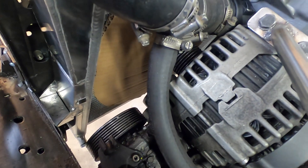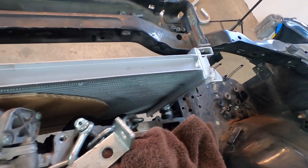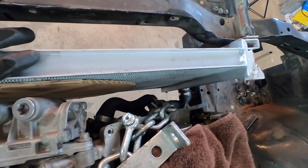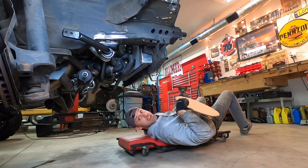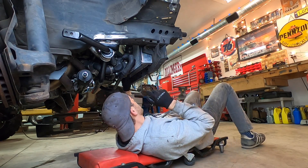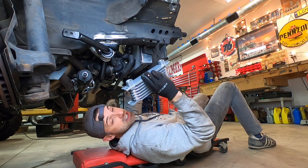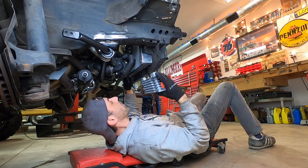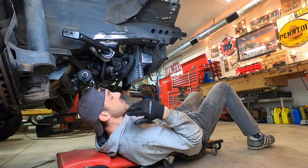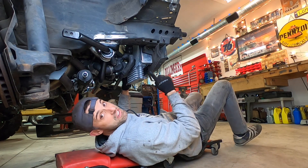I don't want a pusher fan — I want a puller fan to sit between the radiator and the engine, because with a shroud there it actually makes the effectiveness of cooling much better. With the offset look, it's actually going to allow for the oil cooler lines, which are located right here, to snake down the passenger side of the vehicle and go to the oil cooler, which I'm locating underneath the actual radiator. It's not going to be the lowest point in the system, but it will be in a spot where it's out of the way, the routing is simplified, and it gets air.